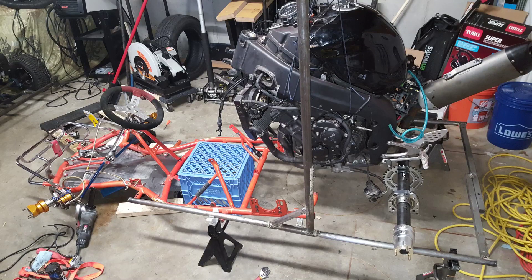It looks like I've gotten a sprocket — this is a motorcycle sprocket with a 530 chain size, and the bolt pattern happens to match the normal European shifter cart hub that goes on the 50mm axles. This is very important because I had to go through many, many sprockets on JTSprockets.com to find a bolt pattern that would work and a hole size that would work. The European hubs use 6mm holes, so I had to take that into account and make sure there was clearance for a bolt to go through the hub without too much play.